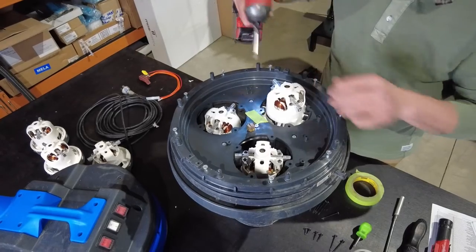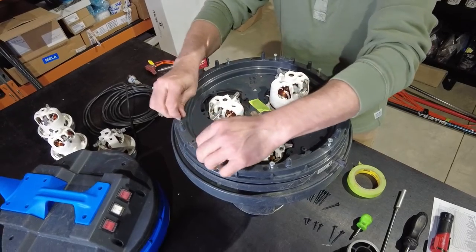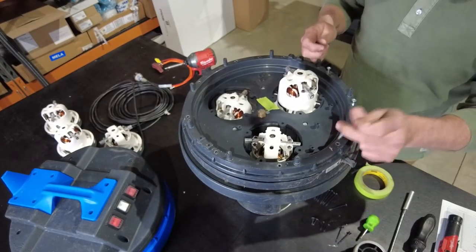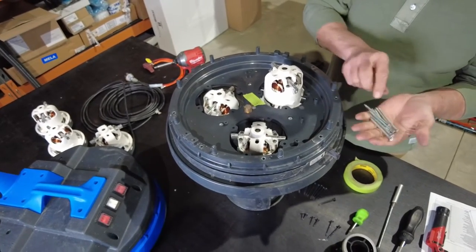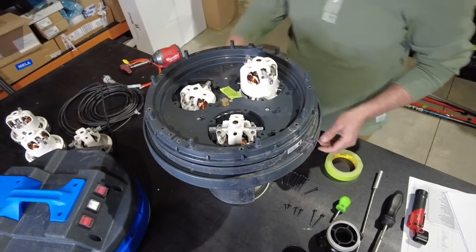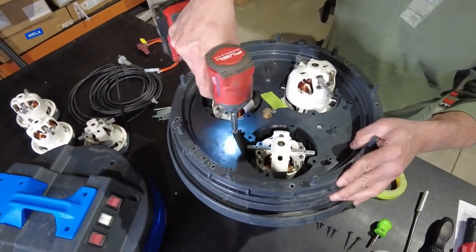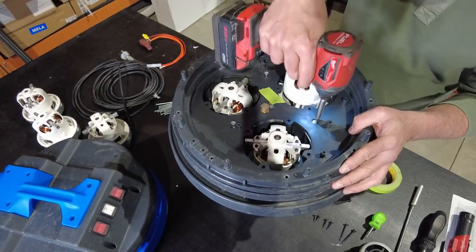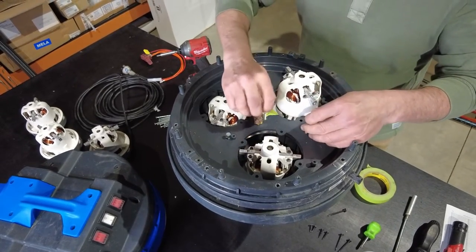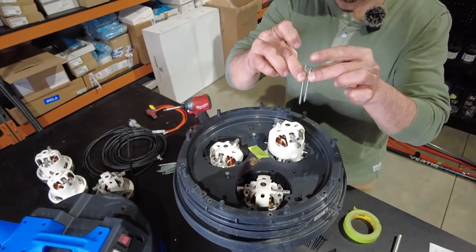This particular vacuum has been submerged, so we're just going through and it's been requested that it's all been dried out. We change the individual motors at a request. So again, countersunk screws, and it's hard to confuse those with the other screws that we've removed, so we'll put those aside. In the centre of the vacuum system itself, there's another three on the outside and one in the centre. The one in the centre is distinguishably longer than the others, so do take note of that.